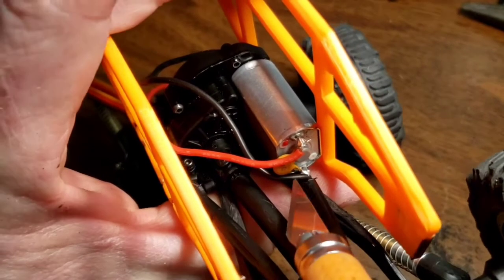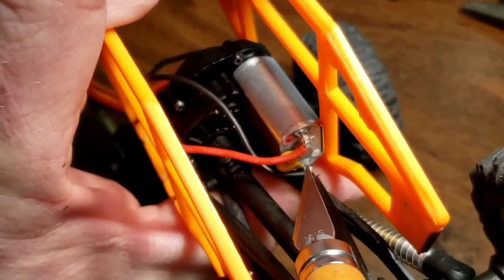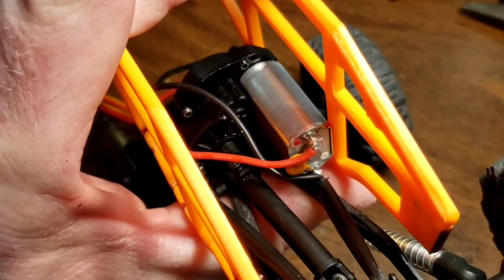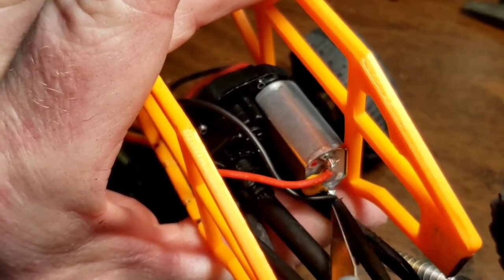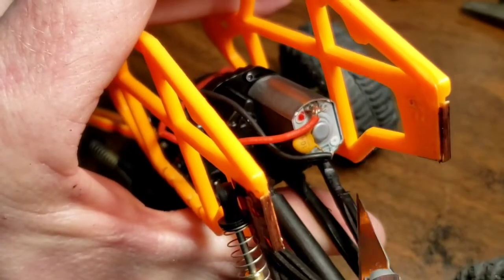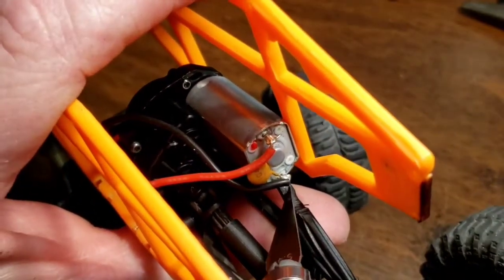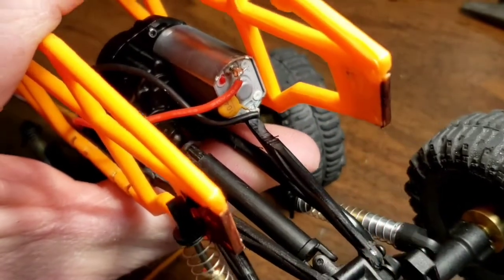the upper rear suspension link will hit the bottom of the motor. I've got a Barrage motor here, and it's a bit longer than a stock motor. It's about the same size as the PN70, but it would sit up higher and limit some of this belly drag, eliminating some of this coming up and hitting the motor. What I've done to compensate for that is chop out half my length. It's not something you would ever see when it's driving, but just a few degrees here equals a long distance out on the end of the arm.